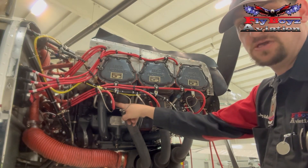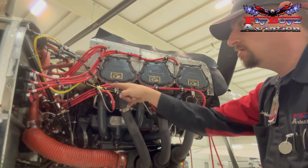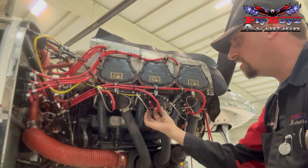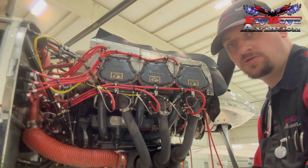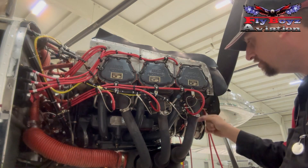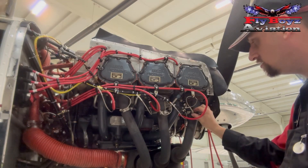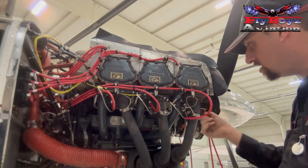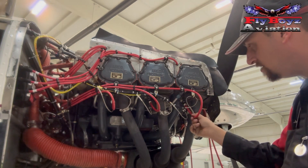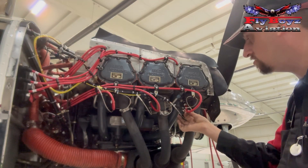I've got number five in the back already started, with that one in the cylinder. I've got my loop and it's clear of the sensors. Same thing here — I've got a loop in it so you've got a rough idea how you're going to set it when you get ready to terminate your ends. This one here, as of right now sitting loosely, I'm sitting on the EGT wire and the CHT wire. So we've got to decide how to manipulate it to maintain our clearance. Once we've got it in there, we can twist it a little bit as we tighten it down to maintain clearance between all the wires.